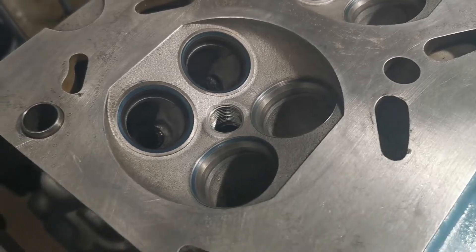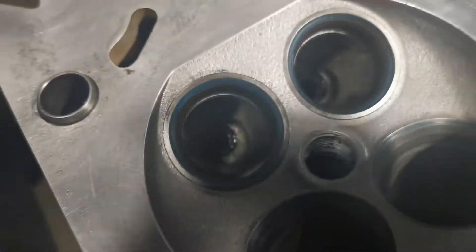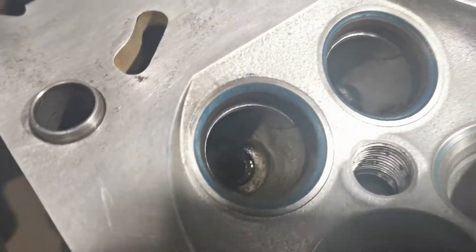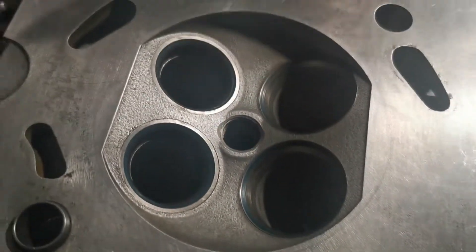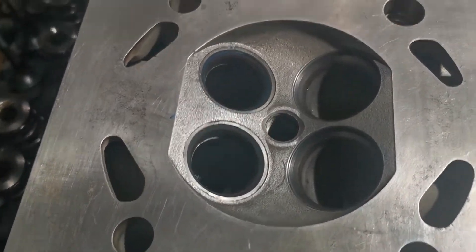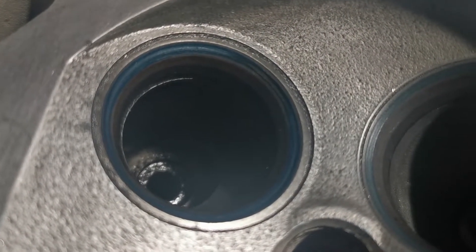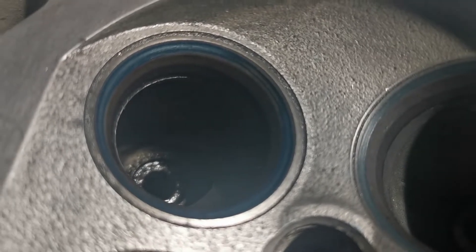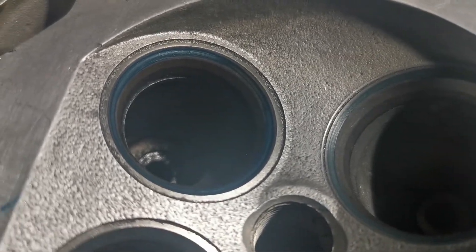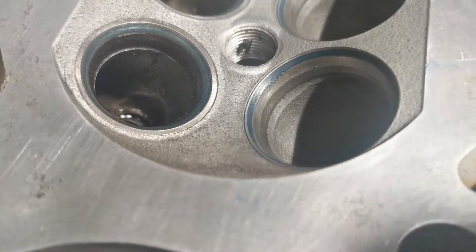So as you can see, after many many hours of polishing, I've used engineer's blue all the way around and you can see in the light it wants to be looking like that - fully seated all the way around, so when it comes back up it's not letting any excess gas through. There's still one I've got to do - you can see that line there with the gap in the top right hand corner. If you strip down the engine this far you might as well chase every little bit you can - that's the kind of seating you're looking for.